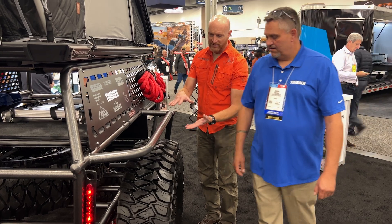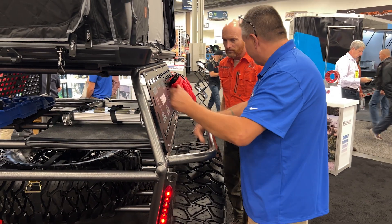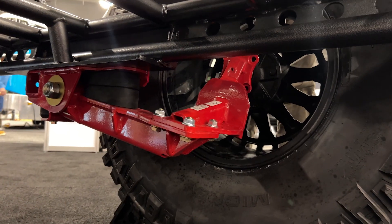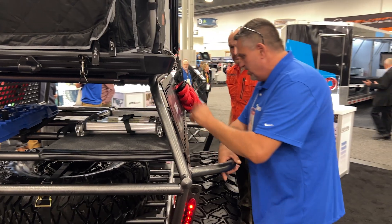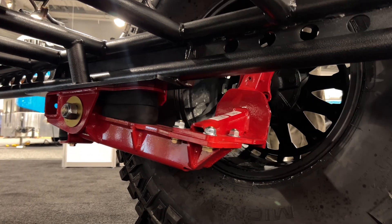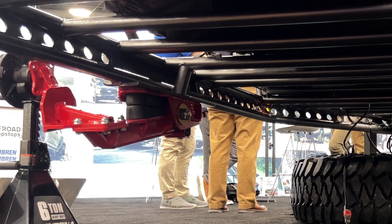Are you able to flex this? Sure, with just this really light trailer? This trailer weighs approximately 1,400 pounds — it's really light. So it's a really light trailer and this suspension is a 2,200 pound suspension, so you've got quite a bit of flex in the suspension. Very supple ride.